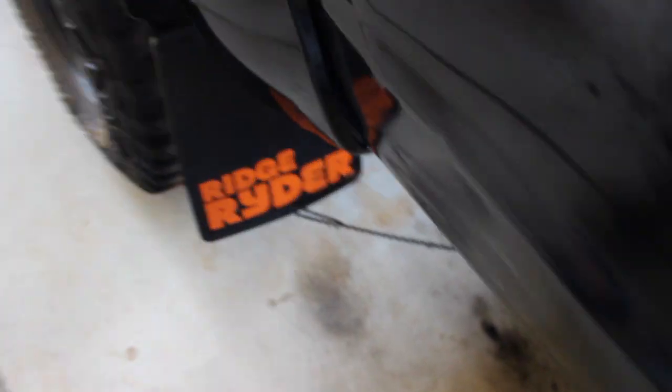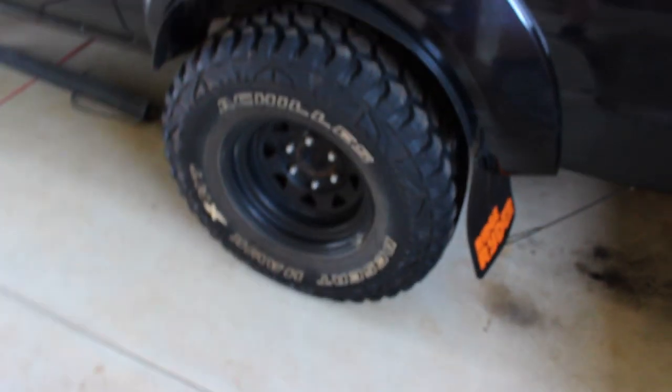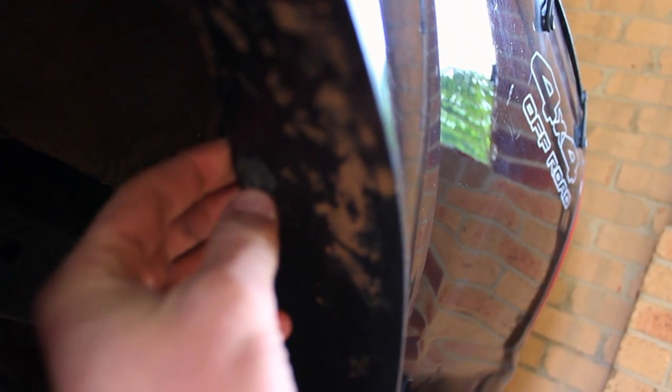Once you get negative offset you will have to — I've got these mudflaps so I can move them over and bring them in line with this, so it's still protected and my car doesn't get affected. Pretty much all it is is I've just drilled holes — it's about that thick — drilled holes there and there, and just replaced the screws which were already there with the plastic.